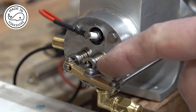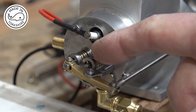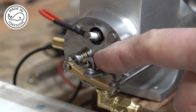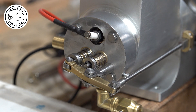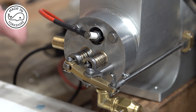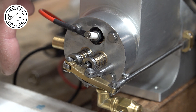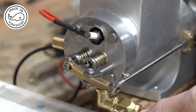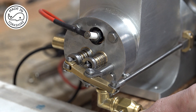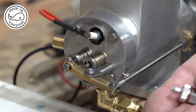Having done that, I decided to put a weaker spring on the intake valve. I've also changed the gap on the spark plug — that was set to 15 thou, I've changed that to 25 thou. For the test run I'll put the fuel tank higher with the fuel pipe entry level with the mixer, so hopefully that will address any air issues, but in the longer term I'm going to use this check valve.